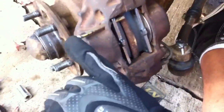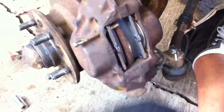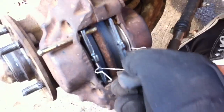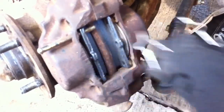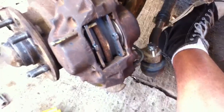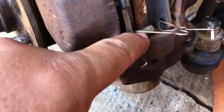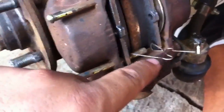I've already got the new pads in there. Now I just have to push these in to hold them in place, put the keeper key in, and then put this spring in here. See how I'm putting this in? That slides back in, and then that pin goes through the inside. What that does is it helps to spread this out. You'll know how to do this because you will have taken it all out, so you'll know how to put it back in.